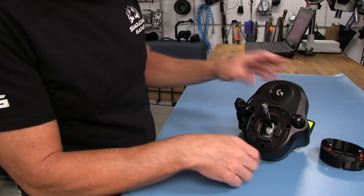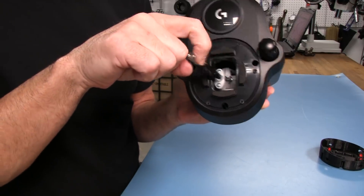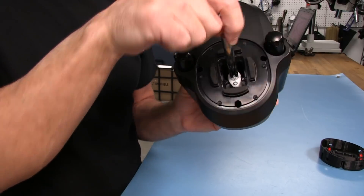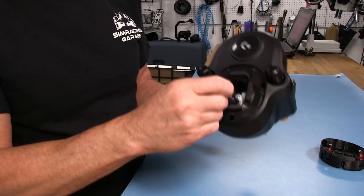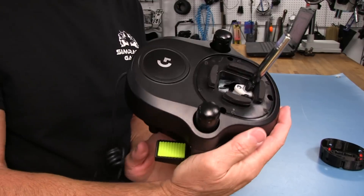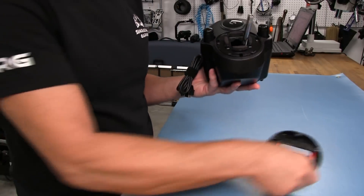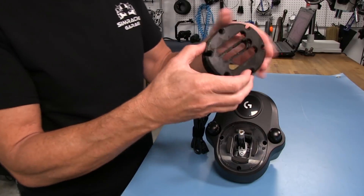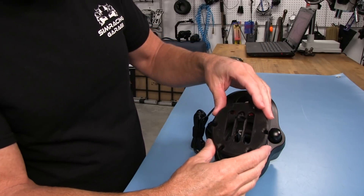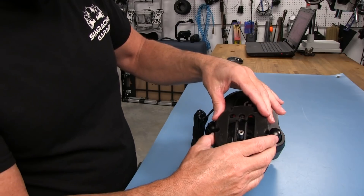So now that we have that off, we're not putting it back on. If you look at my original review of this shifter, you'll know there's a rod in here that goes through this shaft, and the end of that rod has been flanged out. Those flanges fit down into grooves on metal side plates — there's really no gate in here, it's all a simulated gate. When you're in neutral, you push it over and bring it back, and that flange piece captures that side sheet metal. That's what creates the shift, and it will still be doing that. The gate on top is not going to change that. All we have to do is take the new piece and keep it oriented properly — there's an arrow under the bar that points forward, and you want the thicker part to go towards the back.